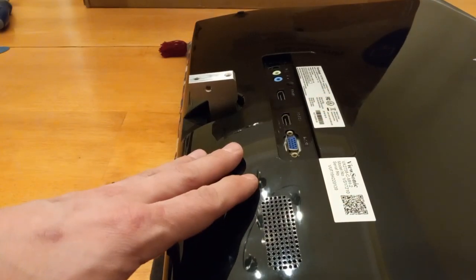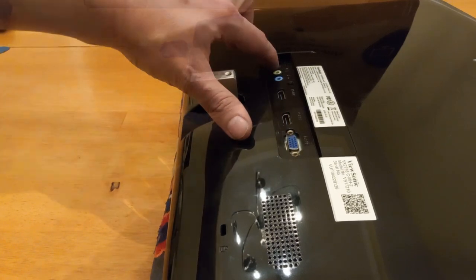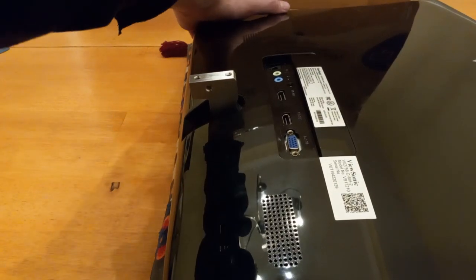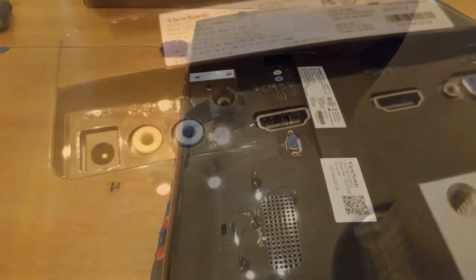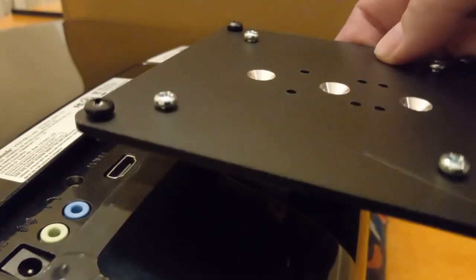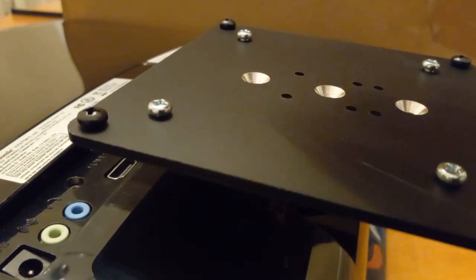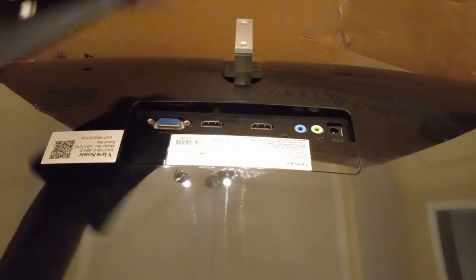Here's the situation with the panel back on loosely. Make sure your ports are all lined up. Snap the back panel in just by pushing it down gently — we only need to re-snap the top and the sides. Replace the screw right here by the ports. You can see how the holes in the VESA plate align with the stem — get the plate situated as you like and attach it with two screws.